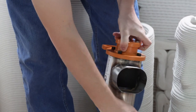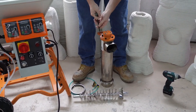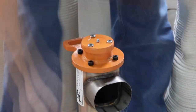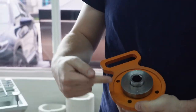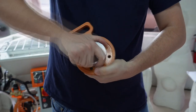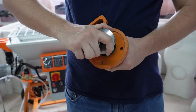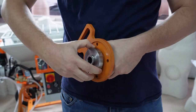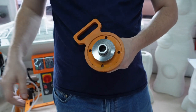You can put them back into place, or if you are having trouble doing so, you can open the end of the mixing chamber. You will need a 6mm hex bit to undo the four securing screws. Here is a close-up of the bearing carrier and the blade stabilizer, and here is what they look like separated. If yours are currently not in place, insert the blade stabilizer first, then insert the bearing carrier. If you are having trouble, slightly rotate the bearing carrier when inserting it.